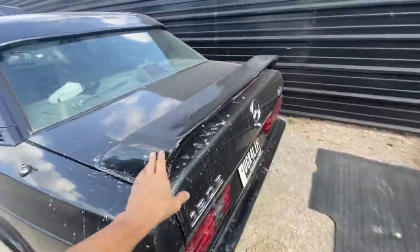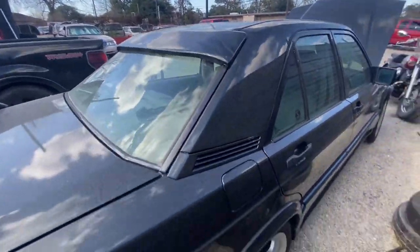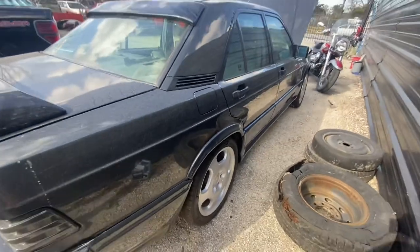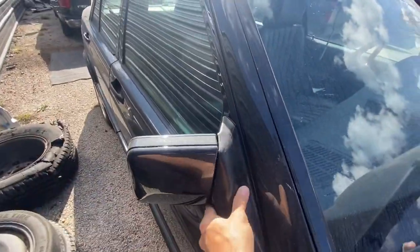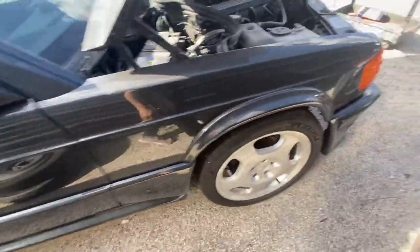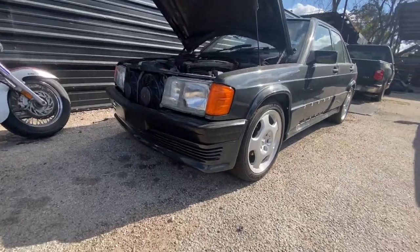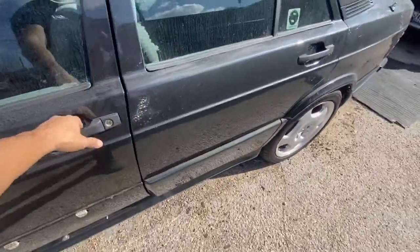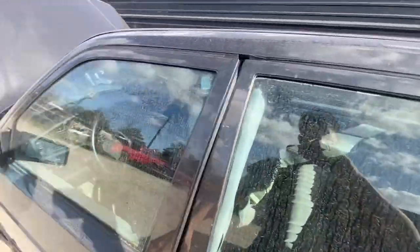We were doing some wet sanding on the wing just to smooth something out, that's why it looks rough right now. He added this top trim piece which looks really nice, added fender flares, and we replaced the rubber on the mirrors because the others were really corroded. We touched up the door handles with flat black, added aftermarket side skirts and a fiberglass front bumper. We gave it a two-tone look with flat black and color match, upgraded the headlights, and put a new grill on. There are a few details still missing — I noticed some imperfections on the paint so I'm going to reshoot that panel.